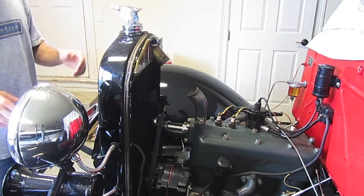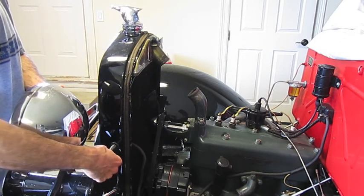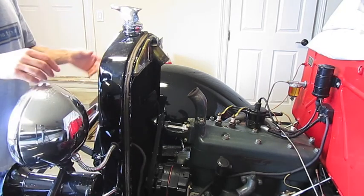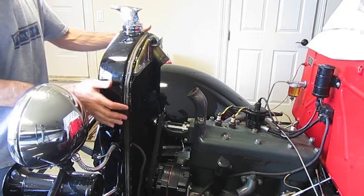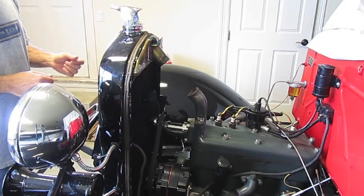Remove the cap. You'll also remove all the electrical wiring in the front — there are conduits here that run wires for the headlights and one for the horn. You'll want to remove those. You'll also want to remove the shell or cowl on the outside of the radiator. There are four bolts that hold that in, two on each side, on the inside of the radiator.